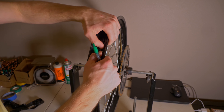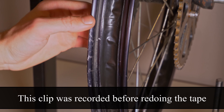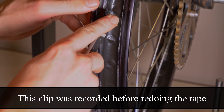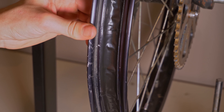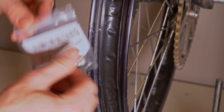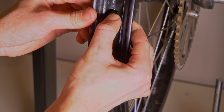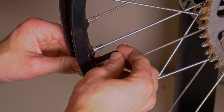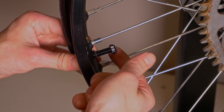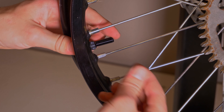That six or nine inch overlap is where the valve stem hole is. You're going to want to make a little X with a knife there — just enough so you can poke the valve stem through. Then take your valve stem, remove the o-ring, and shove it through the tape. Put the o-ring on first, then the locking nut, and then you can put the cap on for now.